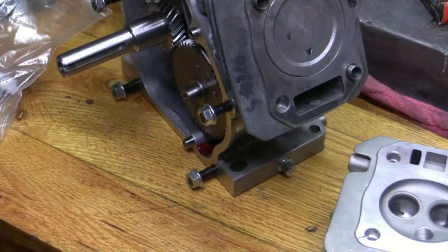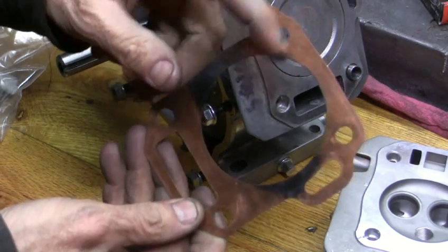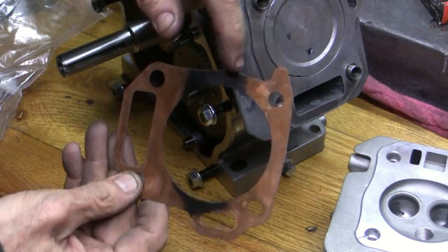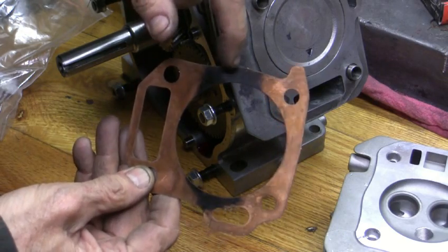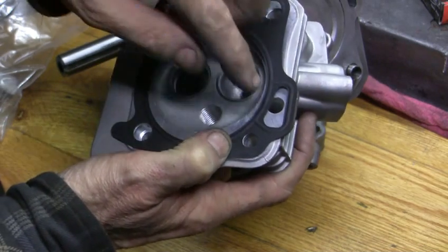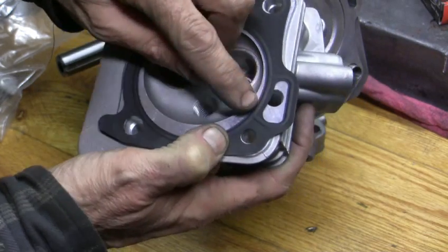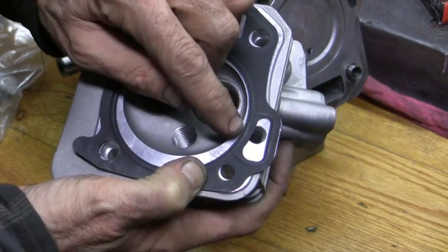So you don't do this — it'll pull this down. What's causing it is these two bolts are too far apart. If there would have been another bolt right in here to draw that down, and another bolt right here — I don't get that. Why didn't they mill it out instead of drill it? Then you'd have more gasket. So you really got to seal this gasket right there — that's really a weak point in the seal on the head of these.